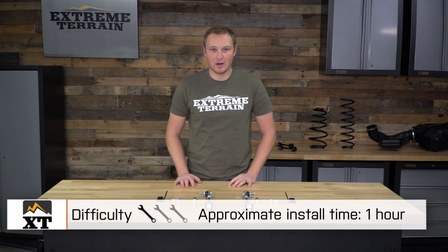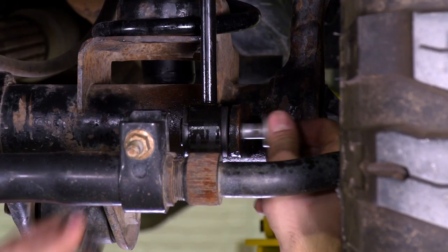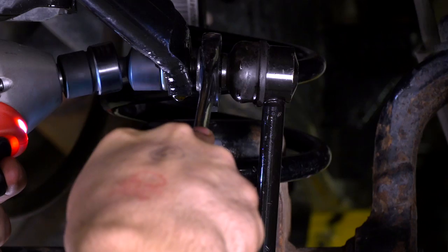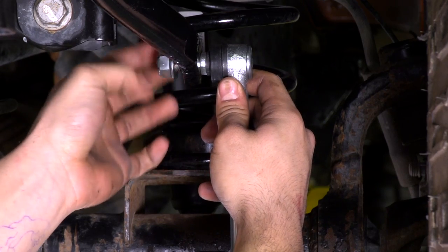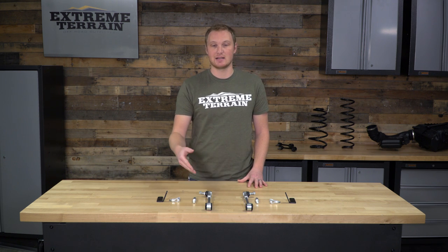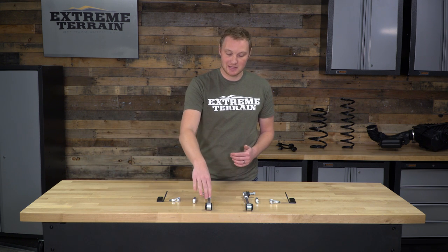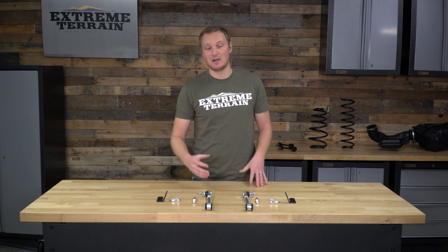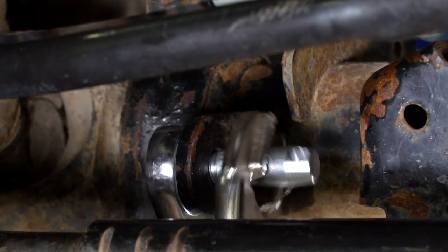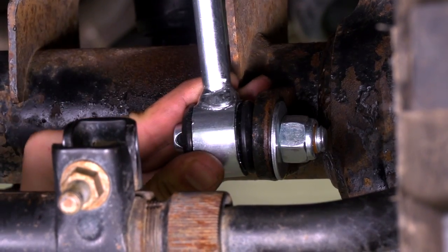The installation of this kit is a very simple one out of three wrench installation. You can get these bolted onto your Jeep in just about an hour. All you need to do is first remove your factory sway bar end links from the sway bar itself and from the axle side of its mount. After that, you'll be attaching your new end link, and this is the time when you want to adjust the end link. This end link is not double adjustable, so you do have to have one end of it disconnected in order to make that length adjustment. You can take a look at whatever sway bar end link you currently have on your Jeep and adjust this one to be right around the same length using the stop nut to tighten it down. After that, you're going to attach the pin to the axle side of your sway bar end link mount, then swing the sway bar end link onto that pin using the retention pin to hold it in place.